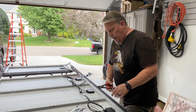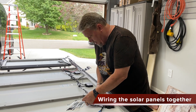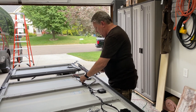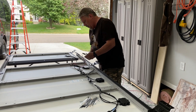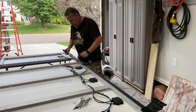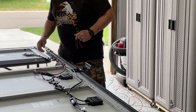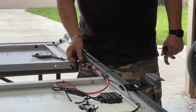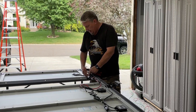I've got it all wired. It's in series — plus to minus, plus to minus, plus to minus, all the way down. I've got it all cable-tied in place. I really don't want this to rattle around on the roof at 70 miles an hour. Right here I connected it to the tube, and then this add-on panel that's going to be in front of the Max Air fan will just plug in right here, and I'll strap that on at the end.